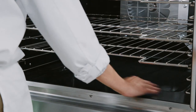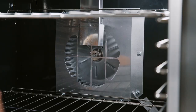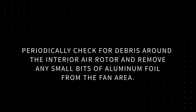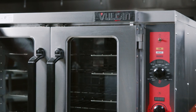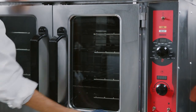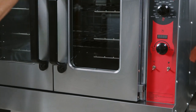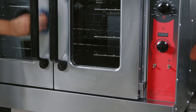One of the easiest ways to keep your oven clean is to always use a drip pan, an optional oven accessory. Make sure to clean the oven's interior back panel. Periodically check for debris around the interior air rotor and remove any small bits of aluminum foil from the fan area. Exterior surfaces may be cleaned using a damp cloth with mild detergent and water solution. When scraping off heavy deposits of grease or oil, never use steel scrapers. Where it is necessary to scrape, use wood, plastic, rubber tools, or anything non-metallic.